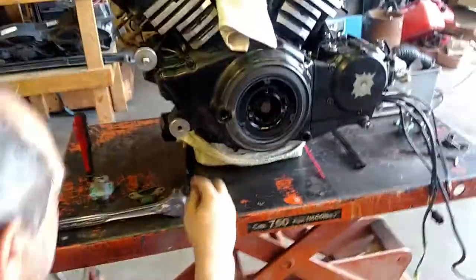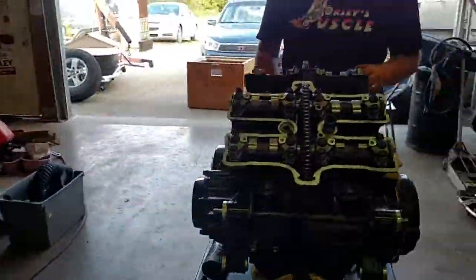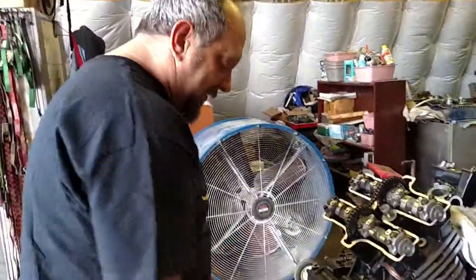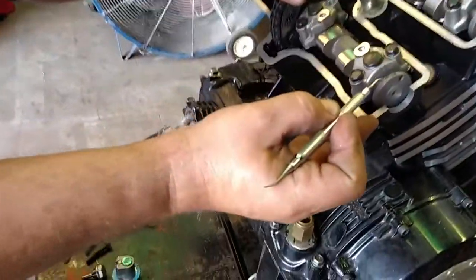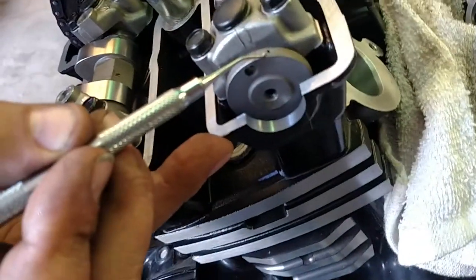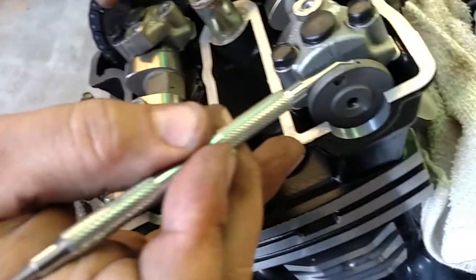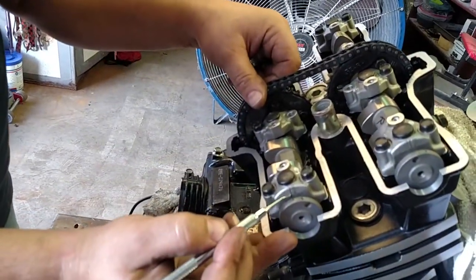Once you've got that aligned, then we're ready to set our cams. When we're doing our camshafts, the manual talks about setting the rear head first and setting it to small dots. When you look on the camshaft you have a small dot, or a small almost looks like a drill bit start, and there's a larger one. Same thing here with the intake cam — there's a small one and the larger one is down where we can't see it at this particular moment. We're going to start out by aligning the rear head T1 small dots to this casting in the cam cap.